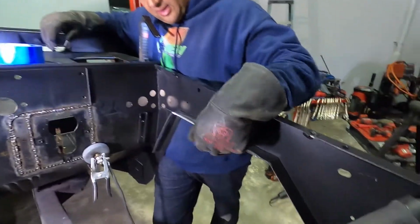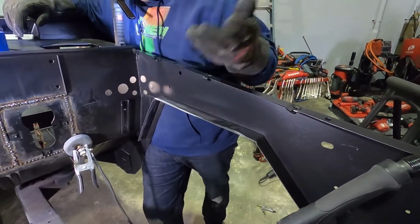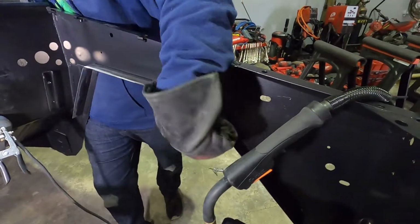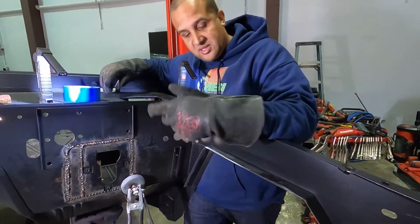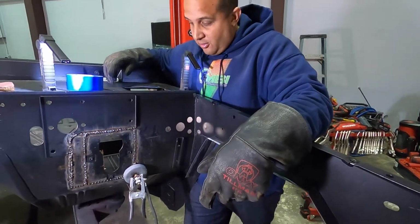But this is so much easier. Just the 3 little cuts, actually it's 1 cut. We're gonna drill the holes, punch the holes from the bottom side, spot weld, it's all done. And obviously if you had Raptor liner, you're gonna run underneath there, you would never see that stuff, but we're not doing that on this one.